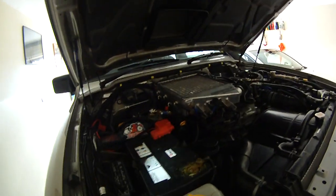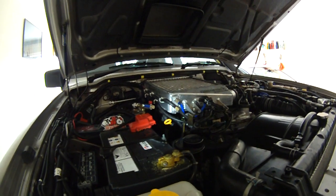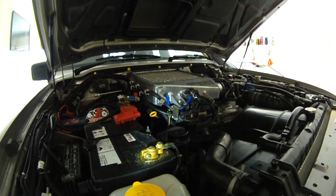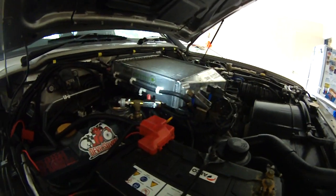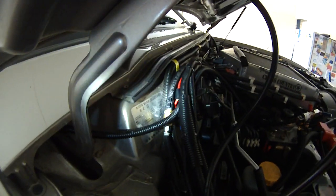Now moving to the engine bay. On the front of my cross-country intercooler there are two boost points. The blue hose is boost over to the map switch. The black hose on that T is the main boost line to gauges and to the doors. This one runs back on this side in 3/16th fuel hose, and again we have a barbed fitting there.